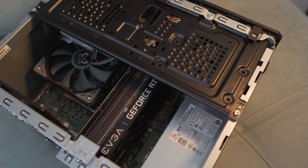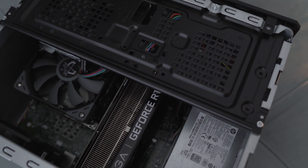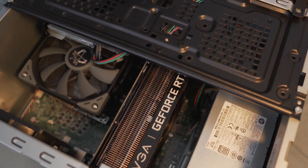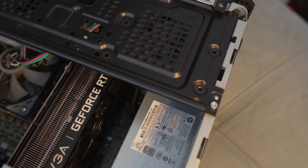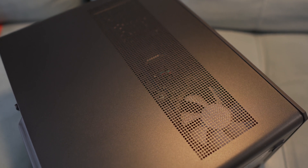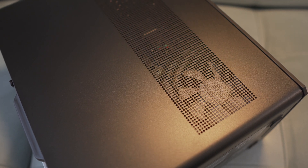This is not going to be a very easy install. It's not going to be a regular just-bolt-it-in situation. It will take a little bit more effort — a little bit more work with a Dremel tool to cut. This section in the bottom, where normally the hard drive would go, is where I'm going to cut to mount that fan. Keep in mind: if you're planning to use a hard drive down there, you won't be able to do this modification. In my case, I'm not using that space, and it's a perfect location for an intake fan because it's right next to the external perforations on the side panel where the passive intake currently is.